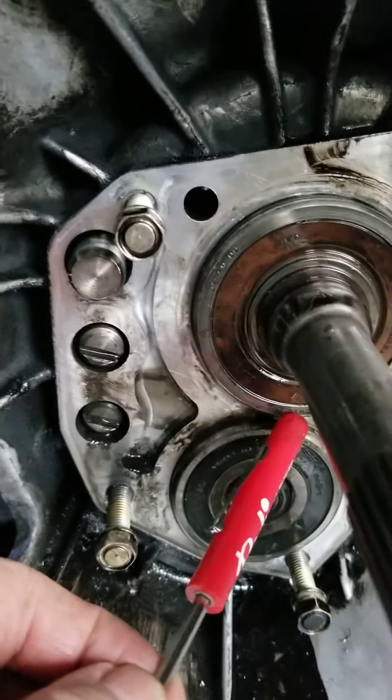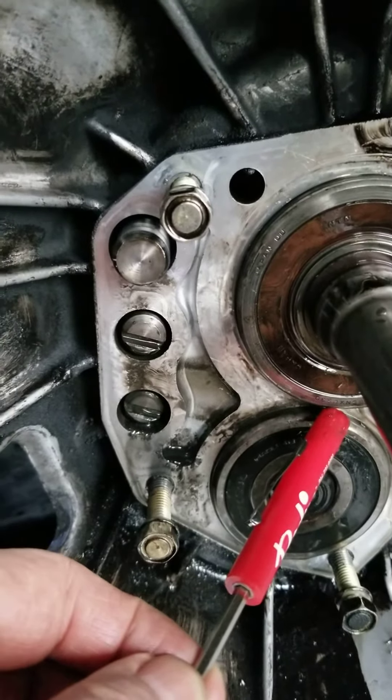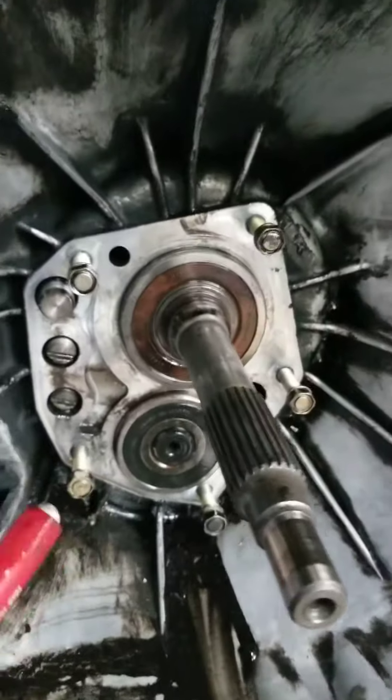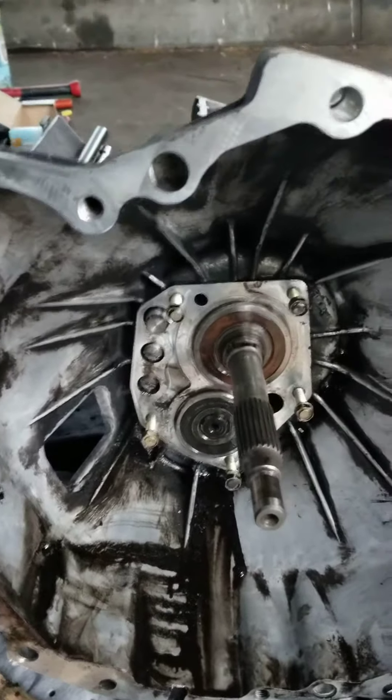You must locate the opening of your snap ring within these two bearings, or it's not going to come out. You can take it out the wrong way, but then you have to replace it because you'll break it. Everyone should recognize this portion of the transmission, so let's move forward.